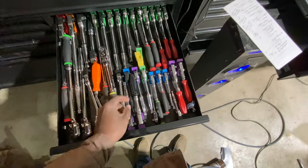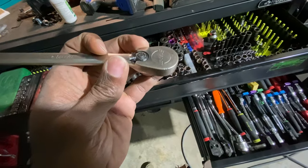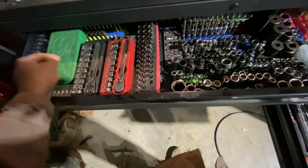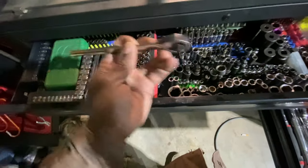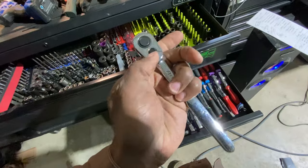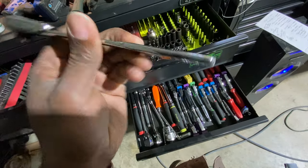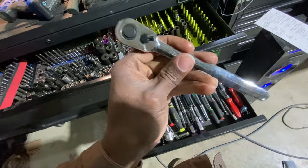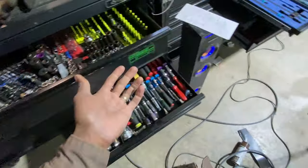There is something to the thickness of the head though. Snap-on has their super thin line of ratchets, and I recently worked on my bike needing a 13-millimeter socket in a tight spot — I was very glad I had those. For thin head applications you don't need Snap-on's ratchet specifically; there are other brands like Premier or Power Torque with just as thin, high tooth count designs. They're cheap and fine since you're not cranking on them — they're for tight access applications.